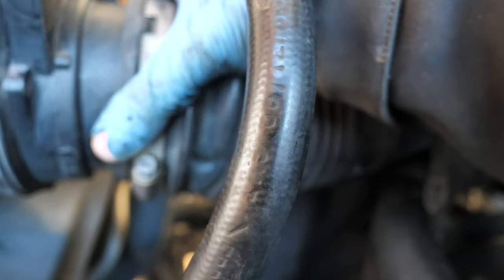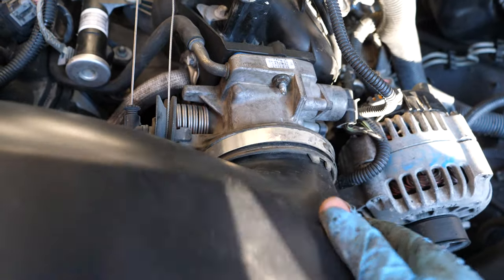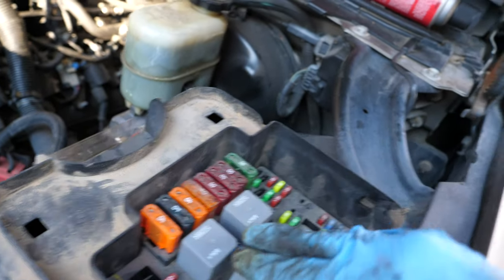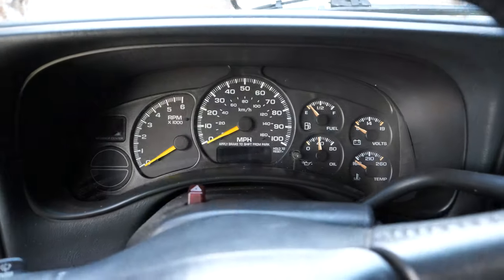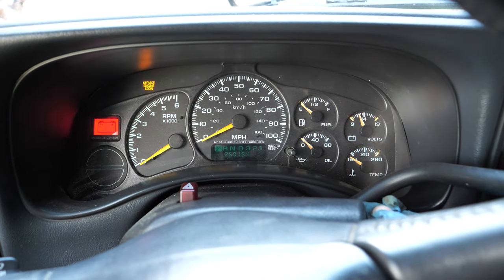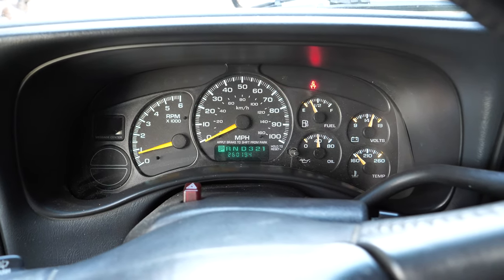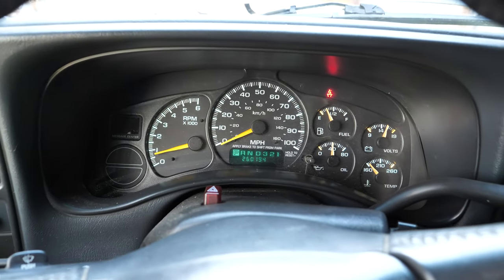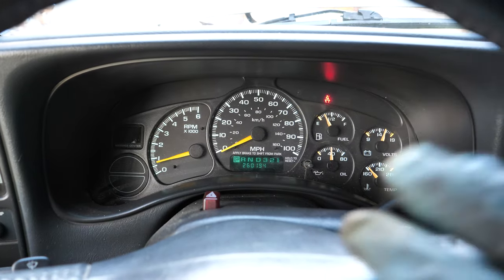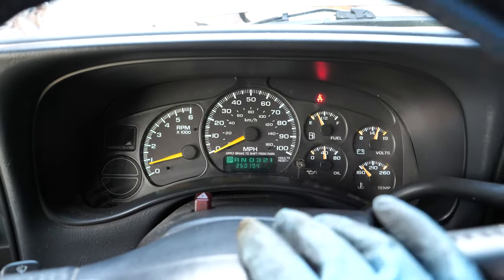Now I've got to put the air hose back in and then the fuel pump relay, and this car is good to start. I'll get this part in place as well as the throttle body. Before I put the engine beauty cover back on, it's time to put the fuel pump relay back in and give this truck a start. Now it's time to turn on the truck — get the fuel pump to prime a little bit. Beautiful. That's what I like to see. Nice clean idle, no lights up on the dash. Pretty sure we're good to go. Just got to drive it a little bit for the sensors to get the right air-fuel ratio and then this car should start idling just fine — just a little bit of shaking, so it just needs to learn a little bit. But besides that, this truck is ready to go.